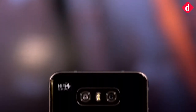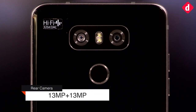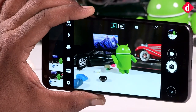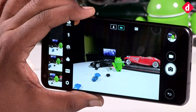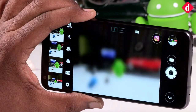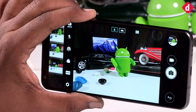There is a slight change in the camera this time. The LG G6 has two 13-megapixel sensors on the back, one of which comes with a fisheye lens. The secondary sensor has been bumped from 8 megapixels to 13 megapixels, while the primary sensor drops from 16 megapixels to 13 megapixels. Using the same resolution Sony IMX 258 sensors on both cameras allows seamless zooming between the two.